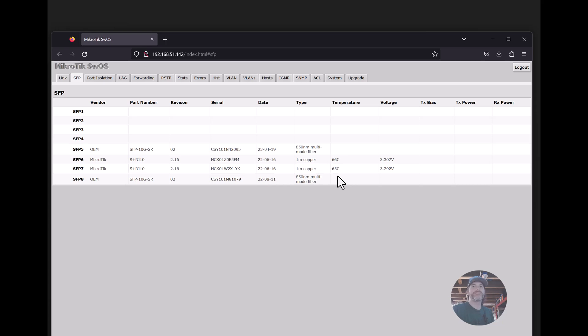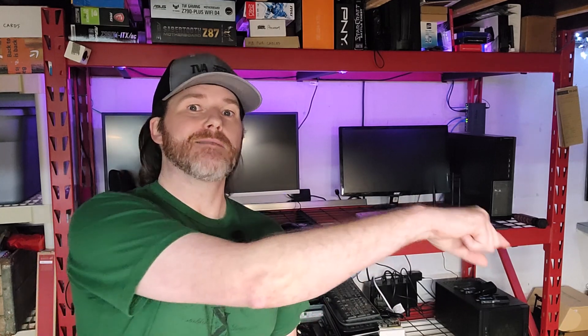Heck yeah! Well, that's a wrap. I hope you enjoyed the video. I'm really, really happy with the results — ecstatic, honestly. A 26 to 30 degree Fahrenheit drop. I wasn't expecting that much, especially with them running in line one right next to another. Now I know I can load that sucker out with RJ45 copper transceivers and there won't be any overheating problems whatsoever. Hope you enjoyed the video. If you like this or other material I put out, check out some of my other videos, give the channel a like. I'm a growing channel and it'll help me out a ton. Thank you much, have a good one.